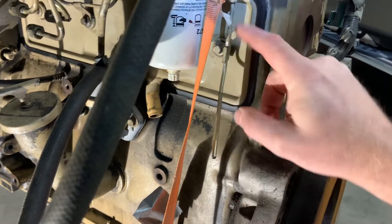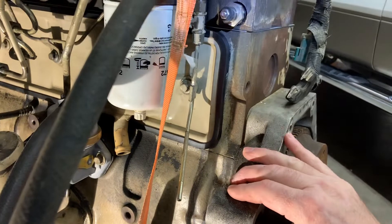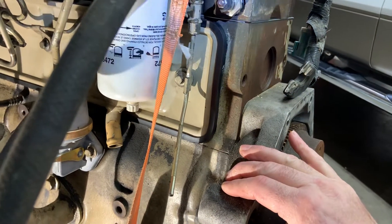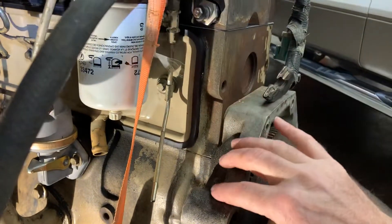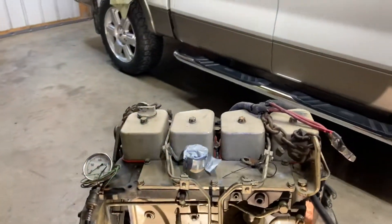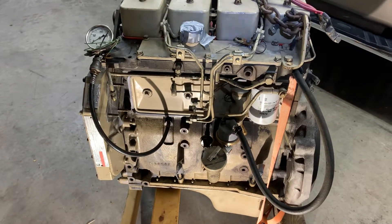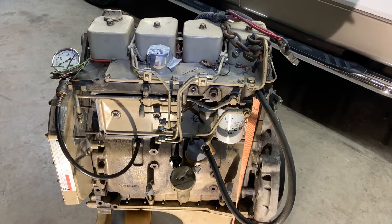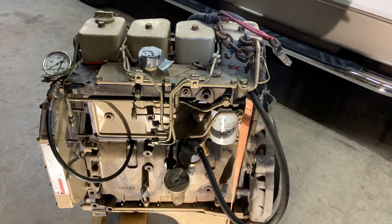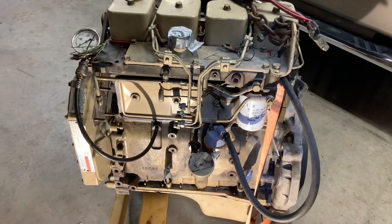Hope that helps everybody out. These fittings do have little rubber grommets — if you take those apart, put a little bit of oil on them before you put them back together so they don't get wadded up as you're tightening, and get them nice and snug. Sometimes it can be complex even though it's very simple in what it is and what it does. Hope that helps any subscriber with questions — drop a comment below and I usually get back to you pretty fast. See ya.